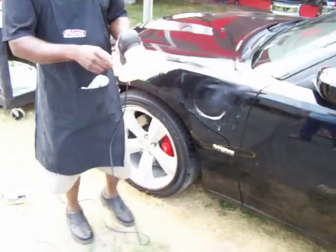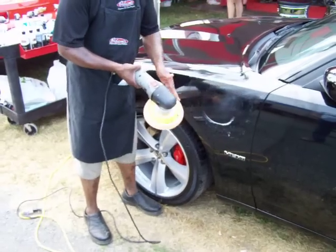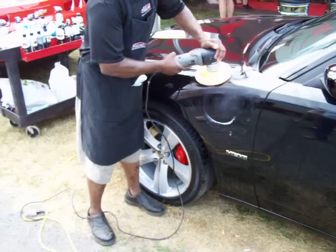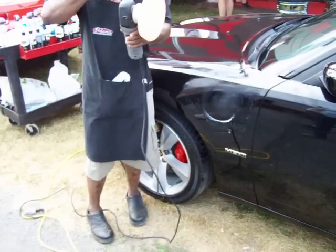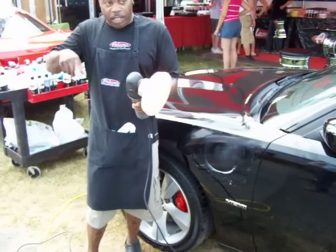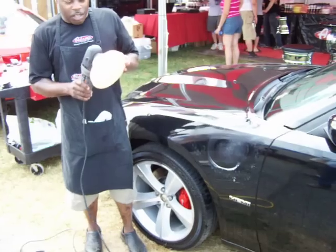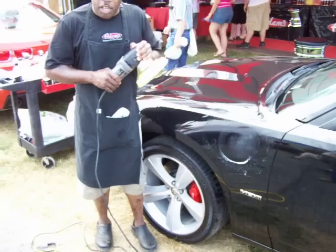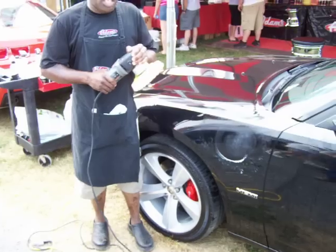Carbon. This is an orbital polisher. It rotates like you see it doing. See that black line? But it also oscillates up and down, actually in a circle. So what it's doing is spinning and also making big circles. It's mimicking the Earth's rotation around the sun. The Earth spins, and the Earth makes big circles around the sun. Because this device will not sit still in one spot on the paint, it cannot generate the heat necessary to burn paint. That's what makes it so safe.